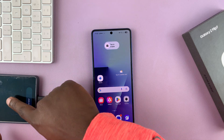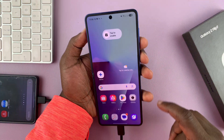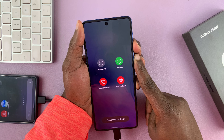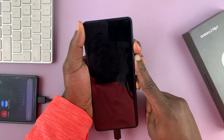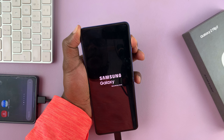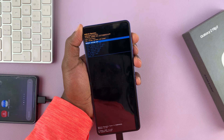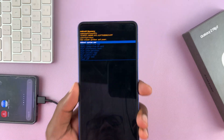I'm just going to unlock this to make sure everything is looking good and ready to go. So: press Power and Volume Down, press and hold. Keep holding until the phone goes off. Then switch to Volume Up while still holding the Power button. Samsung logo appears — let go of the Power button, continue holding Volume Up. And that puts the phone in recovery mode without a computer. Simple as that.